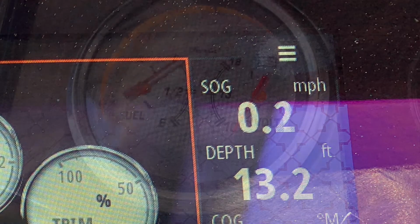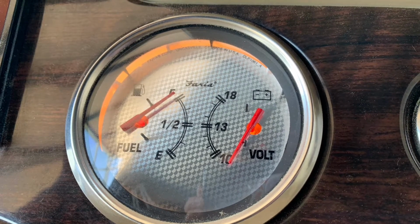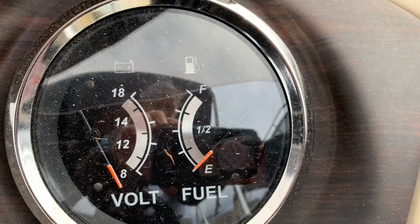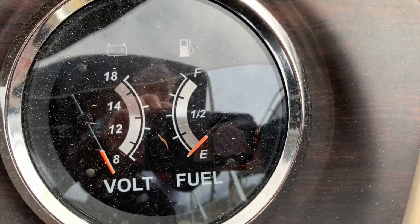Your boat comes with a full tank of gas. We recommend never operating on less than a third tank of gas. Keeping in mind the motion of the water can cause a fluctuation in your gas gauge. If you are unsure of your fuel level, make sure you refuel every 4 hours you are operating the boat.